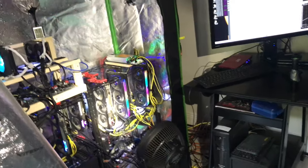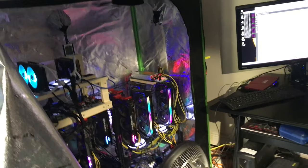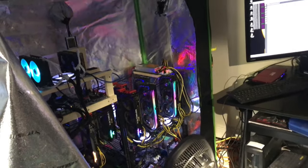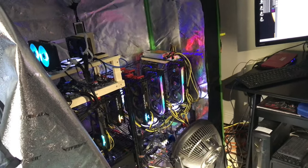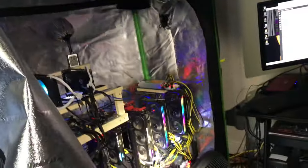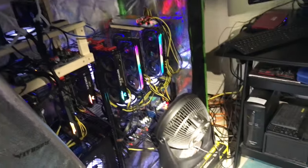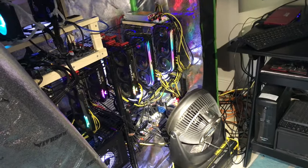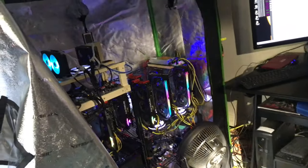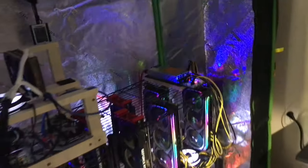Don't inject air. Get the airflow right — those cards are hot and this is working perfectly now. I went from 75-plus Celsius down to 67 degrees. The cards are happier, not causing issues, and the fan motors aren't whining. The heat stays in and goes out through the egress perfectly. Once I have something working I'm not going to mess with it — I'd just spend hours trying to figure out what I broke.